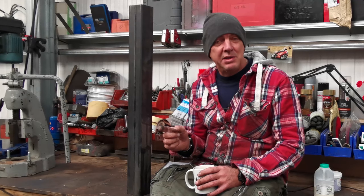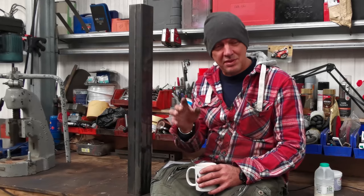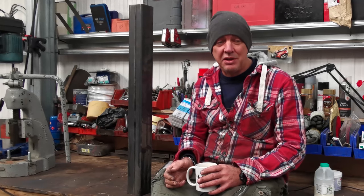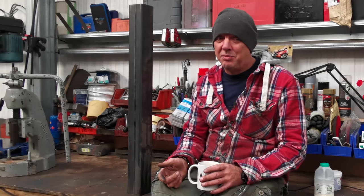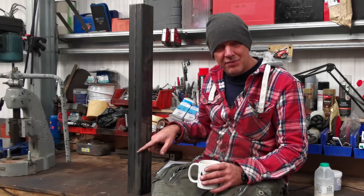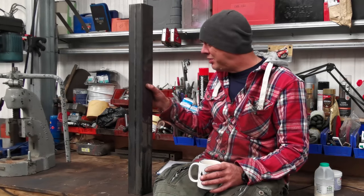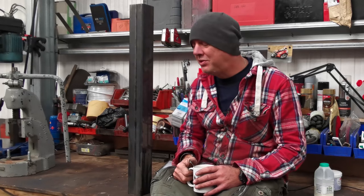All the work I've done on ASBO to this point, as far as changing suspension and the forks and this, that and the other, has all been based around that geometry, and I don't want to change it. However, later on, if I wanted to change the geometry, I can just change the headstock, or move the pivot position for the swing arm, or if I wanted to stick a different engine in, I'll just do another one of these with different pickup points for the engine mounts. So it should be quite versatile.